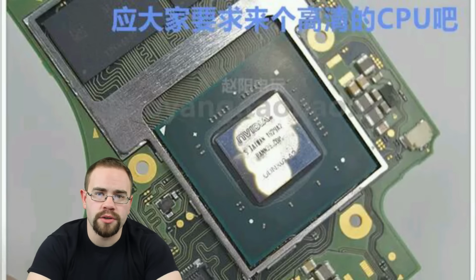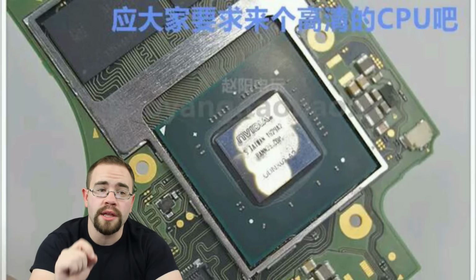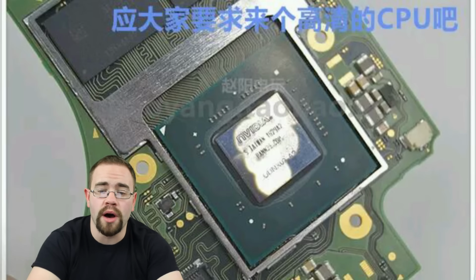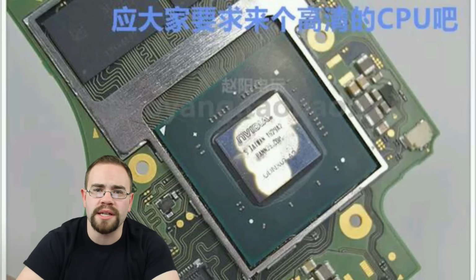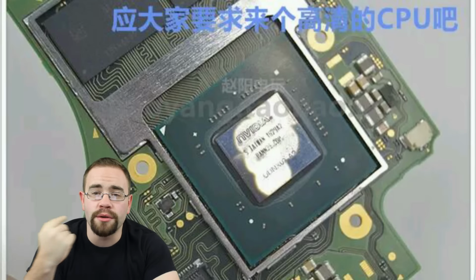The other chip that I'm referring to is it looks very similar to the newer Shield TV, the 2017 model. People have taken pictures and compared them. Looks very, very similar. However, the codes on the front for each die are different, which tells me that they were manufactured differently in terms of timing, and they probably have different things in each one. I have a feeling that Nintendo's, their Switch's SoC is heavily customized to the point where it fits what Nintendo needs it to do, rather than go into the Nvidia Shield TV that is running Android and is mostly set up as like a streaming device.